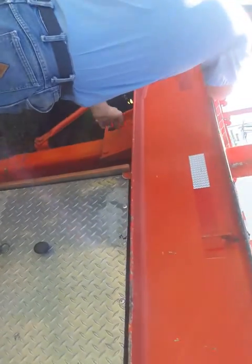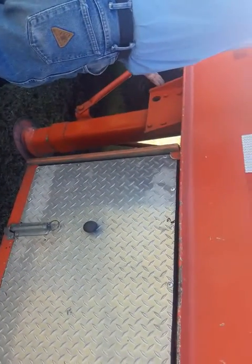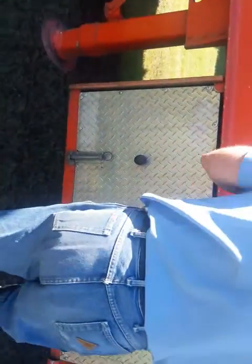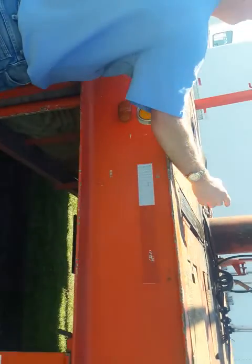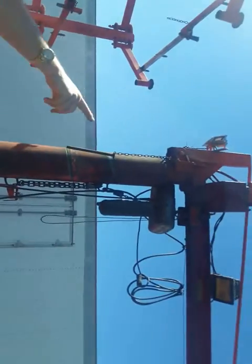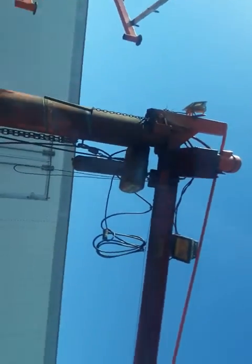Make sure your landing gear has no missing or broken bolts. Make sure the landing gear's all the way up. All right, check your load door. Make sure it's properly secured. All right, now you're going to check 3 foot of frame, cracks, broken welds, missing or broken bolts. You're going to look up, make sure your boom is properly all the way down and properly secured.